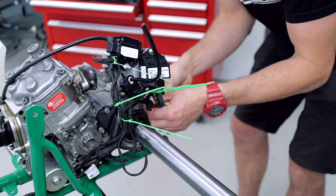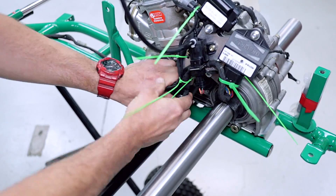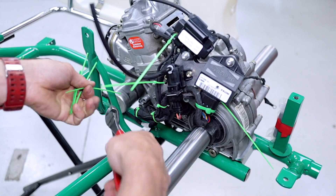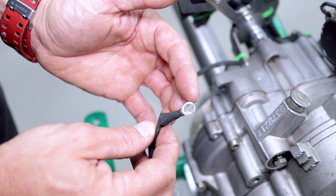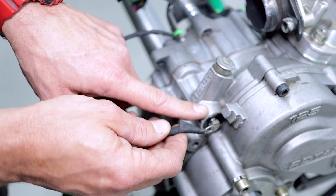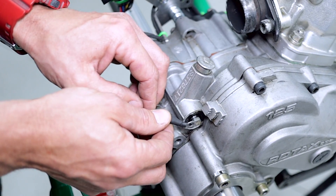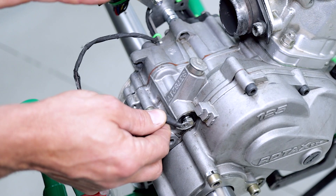That's the shift cut wire — just get that out of the way. This spare wire in the Rotax wiring harness is actually the DD2's shift cut wire and it's going to go over onto the gear selector unit, which I'll show you in the gear selector installation video. When you pull on the gear selector, a little bit of pressure and a spring comes across and makes contact with the engine — it cuts the ignition so that the gears are free to change from first to second, second to neutral, and back into first.